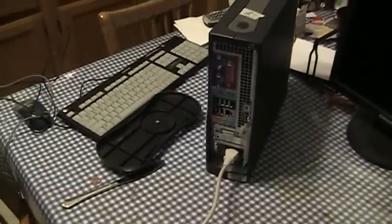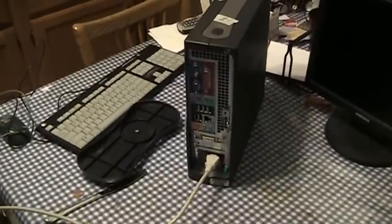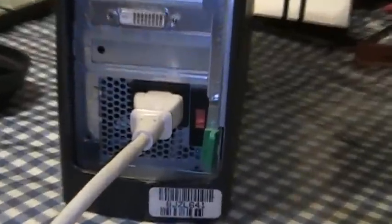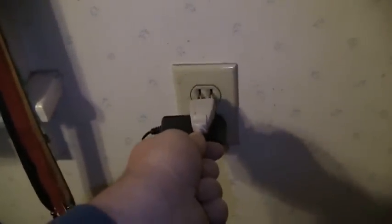So that's the first thing we're going to do, folks. I've got a power cord right here. I'm not going to plug any peripherals into this system that I care about. The two times that it happened on the 4600C in question, which is resting downstairs in my computer parts mess, it was the standby section of the power supply that blew up, and it was conductive glue that had been white and compliant originally, had turned dark brown and conductive, shorting together things that were never intended to be shorted together, and that was what caused the blow up in that case. I'll go ahead and check the voltage selector. It's set to 115, so we should be good there. And then, well, there's nothing else that I can do. I can't stall anymore. It's time to live vicariously, thanks to the advantages of time delay fuses.